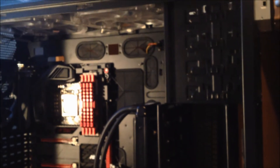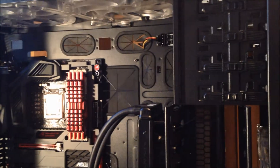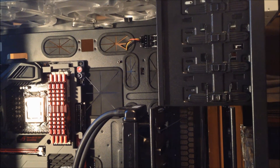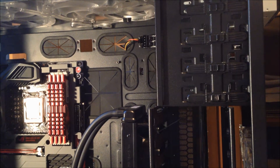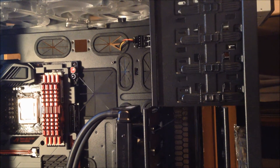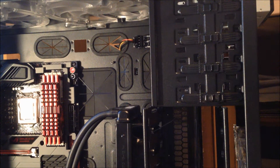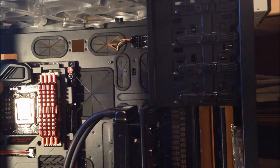What we're gonna do next is hook up the SATA cable. This is really not that hard either - just like with the storage, the hard drives - basically the same idea. You're gonna line up the little notches in the cable and you should be good. I'll take the SATA cable and plug it into the optical drive up there, and probably run it down through one of these holes and have it come out over here.